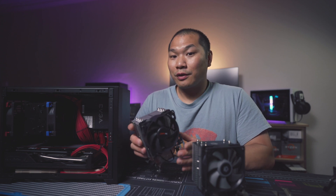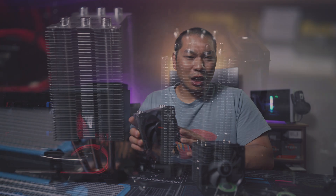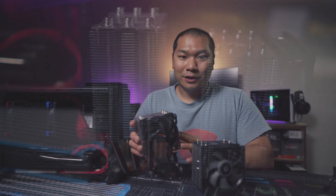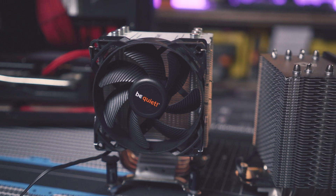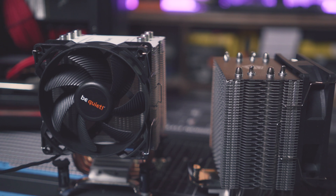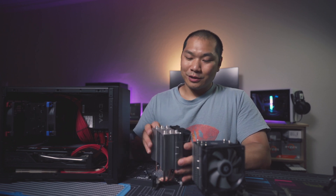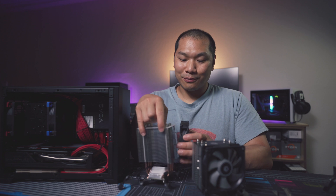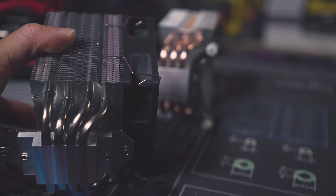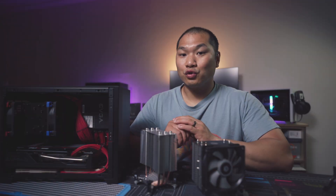So you've seen the results — I'll share a few quick thoughts on each one. The BeQuiet cooler is competent, but there's no arguing that the performance is inferior to the ID Cooling unit. It's a bit odd at one centimeter taller, plus it has a very basic mounting mechanism. It's not a bad cooler, just very bare-bones with the lightweight construction and only three heat pipes. I think this would be a good replacement for a stock Intel cooler, but I wouldn't run this on anything more than a 10400 or 11400 level of CPU — there's just not enough cushion. One other thing I noticed: the fan clips are super annoying. There's just a tiny little sliver that sits in the fan mounting hole, as opposed to a normal clip like on the ID Cooling one. This fan clip barely stays in the fan and will just pull out super easy, so it might take a few tries if you're mounting it up in a case.